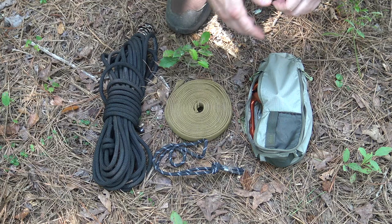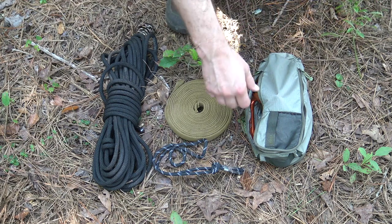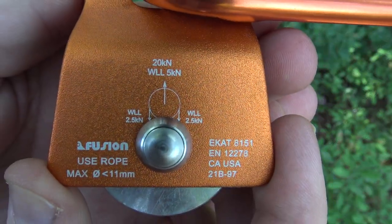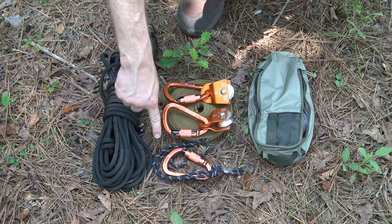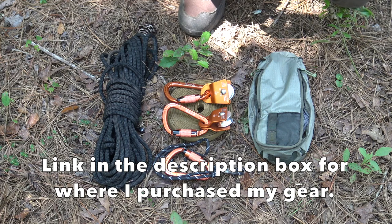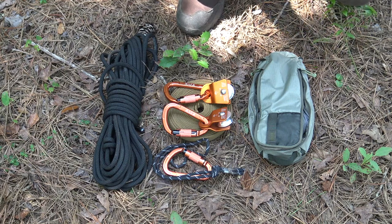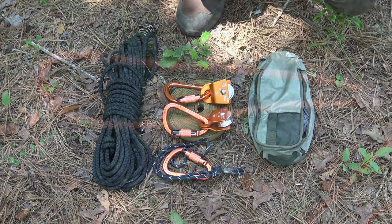My simple kit also has ridgeline stakes, toggles, and things for setting up an emergency shelter, which is part of my ATV kit in case I get stuck overnight. For this recovery purpose specifically, I have two climbing-grade carabiner and pulley combinations — heavy-duty carabiners attached with pulleys — and then one additional heavy-duty carabiner. So in summary: a prussic loop, three carabiners, two pulleys, and rope. With those items we can recover this four-wheeler from a gully. It's simple, not too expensive, and definitely cheaper than a winch, though a winch would be the better option.